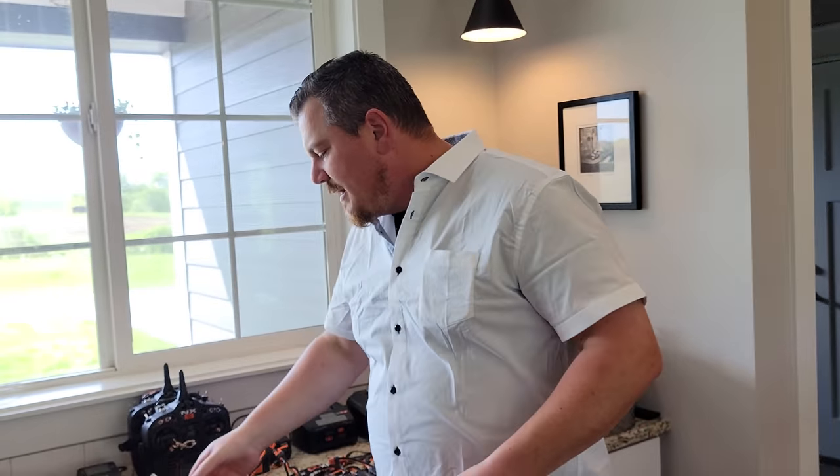Okay, slide that back, get it to seat all the way, and then take your flat washer, your nut, and then your spinner, and I've got a screwdriver as well. Now this is something you have to be careful to do right, because here, if you don't do it right, you may have a prop spin off on you, and that's a mess.